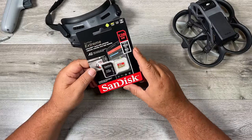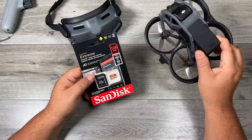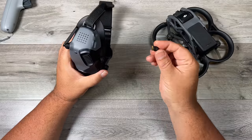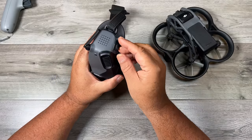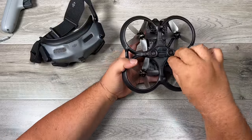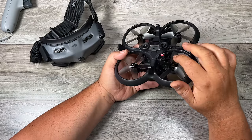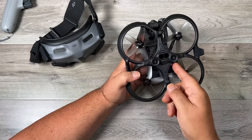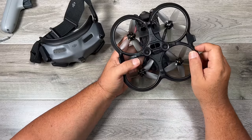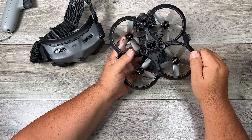At this point, you're going to have to decide what kind of memory you want to use. I like to use the SanDisk Extreme — right now I have a 256 gigabyte card in the drone itself and a 128 gigabyte in the goggles. To install the memory in the goggles, take the card with the graphic facing down and slide it into the memory card slot, pressing it in until you hear it click. For the drone, pull that door away. You want the graphic side facing upwards, then press it in until it clicks. It can be really fidgety — it's kind of a poor place to put the memory card on the drone. If you have really thick fingers, you may have to take the propeller off to get at it.